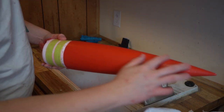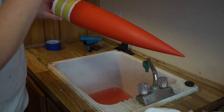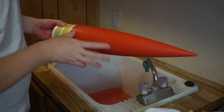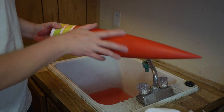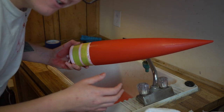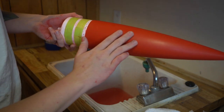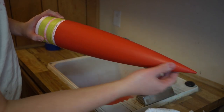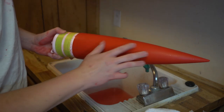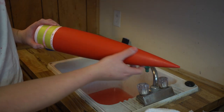This is sanding out to 2000 grit. If you were really about this life and wanted a crystal-clear perfect reflection paint job, what you do is stop right here, let it dry 24 to 48 hours, then spray two or three coats of clear and do this whole thing over again — starting maybe at 600 grit, going 600 through 2500 or 3000, then buff it. But I'm not that concerned. All these marks are still low spots — it would be a lot better if those were knocked down smooth, but I'm afraid of going through the paint. This would be a perfect foundation for clear coat, but I'm just going to buff this out with 3000 grit, which is basically just polishing at this point, and then hit it with some cutting compound or wax and be done.